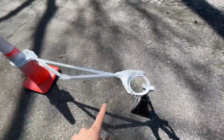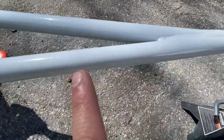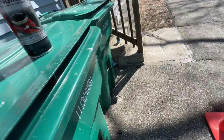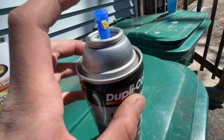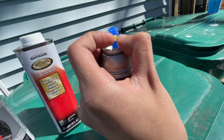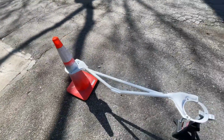Before I put the clear on, I'm gonna wet sand, because if you look close you can see some little dust particles or whatever, from when the spray tip was spraying. I cleaned it off with acetone. I recommend you really clean off your tips before you paint. It would just avoid a ton of splatter.